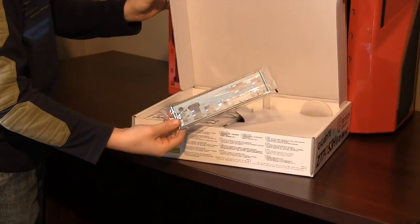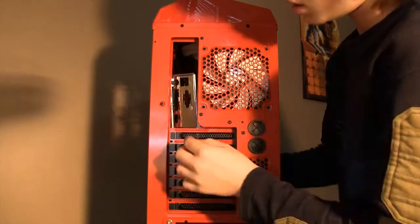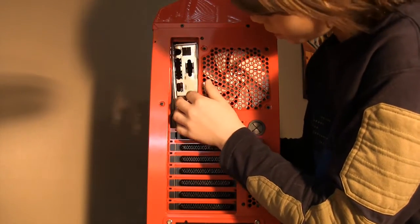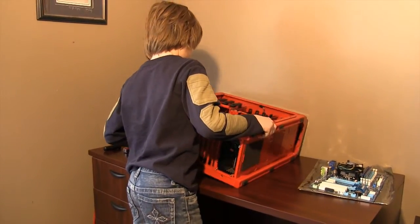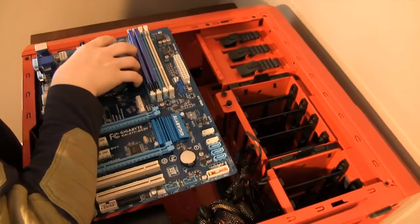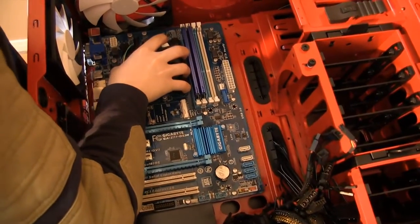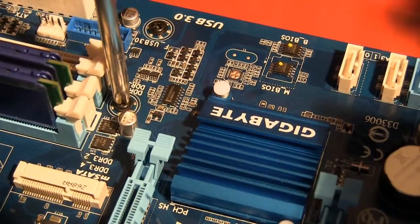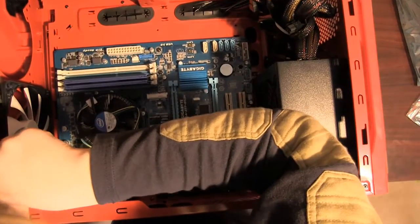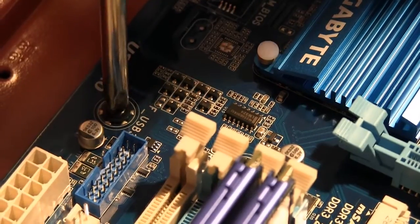Next, locate the IO shield inside your motherboard box. Align it up against your motherboard to see how it'll fit in your case, then align the IO shield correspondingly and snap it in. Lay your case down on its side. Grab your heat sink and adjust your motherboard to line up with the standoffs — the ports should poke through the IO shield. This can be tricky to negotiate. Screw the motherboard in place with the hardware provided by your case, getting all the screws in loosely first, then tightening them afterwards.